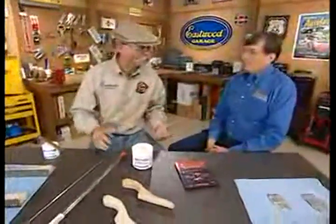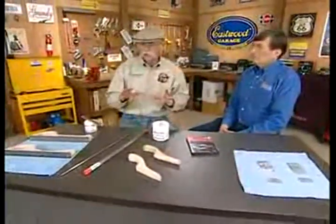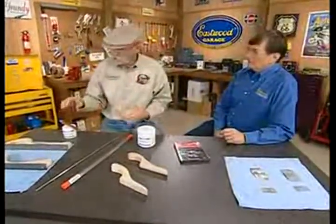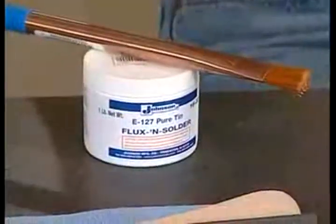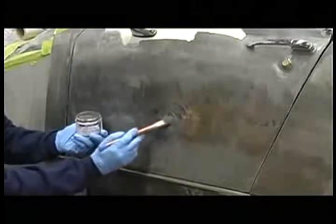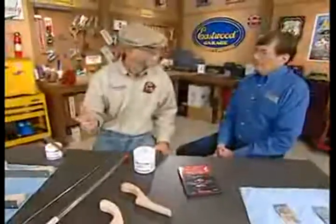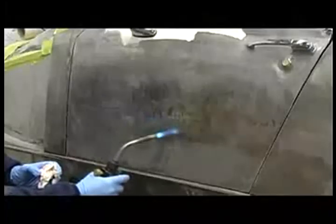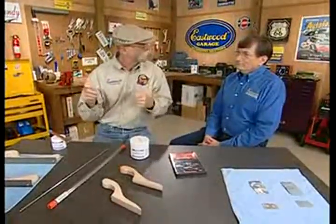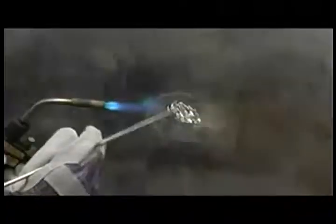Let's talk about the process of filling a crease in a door or something like that. First of all, I'm going to clean the metal as I would any time — get it nice and clean and down to bare metal. Then I'm going to brush on a tinning butter, which serves the same purpose as a flux in any solder process. I put that on, then hit it with a torch to heat it up. A simple propane torch works fine — you heat it until you see it turn slightly silvery, then wipe it to spread it across the repair area. Now the area is ready to accept the lead-free solder, so I use the same torch, heat the metal and solder at the same time, and tack it on there.